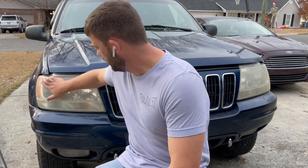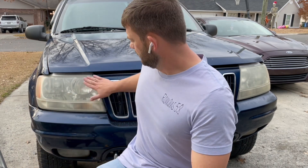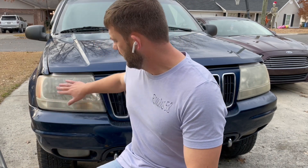These are nice and fogged up. What we did — we've already hit it a little bit with some very very light sandpaper, or if you have a very light scuff pad, I'd say probably a thousand grit or higher. Just lightly go over and scuff it out. You want to smooth out those pits, but not too much because you don't want to scratch your lens.